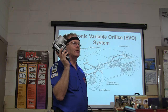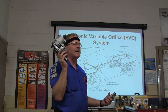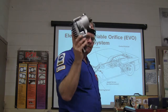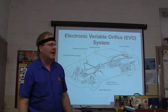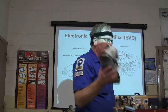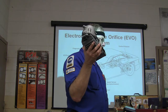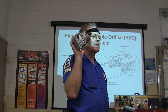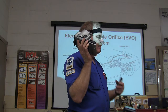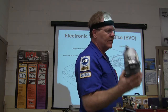If you're checking under the hood of a vehicle and trying to find the power steering, how do you find the power steering reservoir? Find the belt — find where the belt is driving the pump. Notice the pulley on the power steering pump is pretty big compared to the alternator. The speed isn't as important as the power it takes to turn it, because it's putting out 1,200 pounds of pressure. On those Cobalts and Pontiac G6s, this electric steering module loves to go bad — this is the one we changed out, it cost about $500. They had a recall on them for a while.